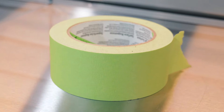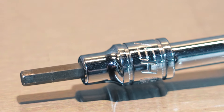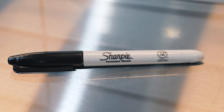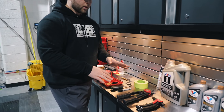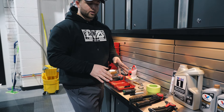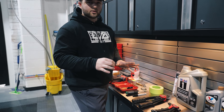You're going to want some masking tape to protect the finish of your spoiler while you're installing the Wickerbill. A screwdriver is optional, but we do have a 5/32 allen key on the screwdriver — this is going to be the size of your LVA hardware; a 4 millimeter will also work. You're going to want a Sharpie. The most important tools are the rivnut tools — you can use one or the other, but if you do not have this tool, you're not going to be able to get the installation done. Unfortunately we do not provide these tools, but each Wickerbill listing on our site has a direct link to Amazon. You're going to want an M6 rivet tool so the threads are M6.